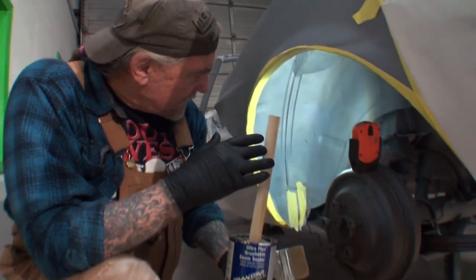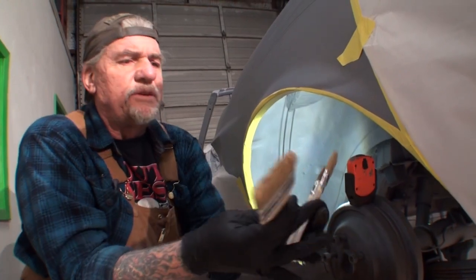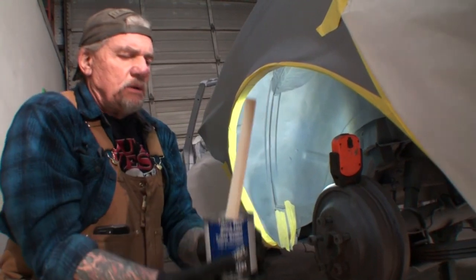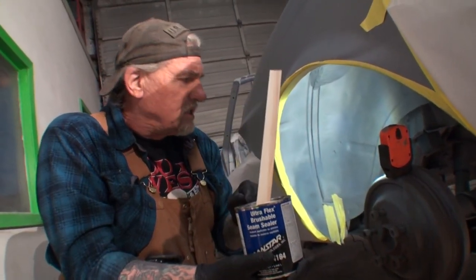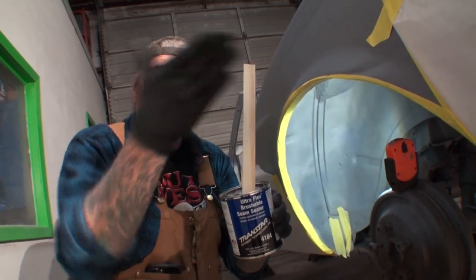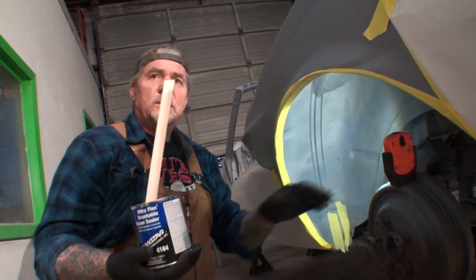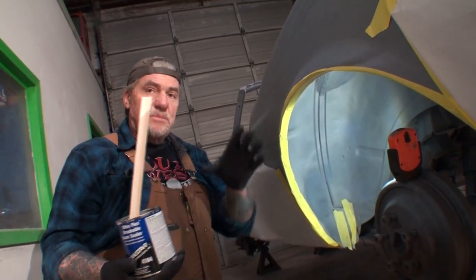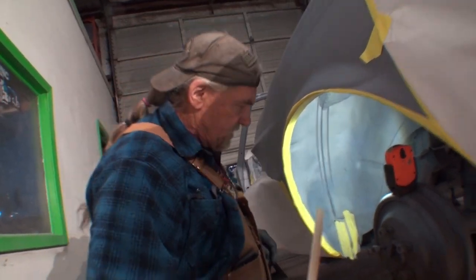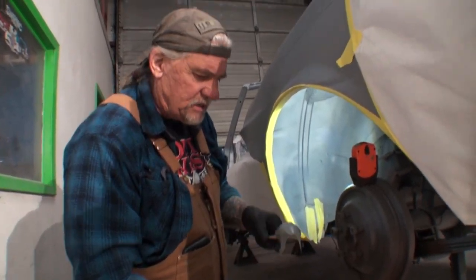All right, so I got my seam sealer, I got my paint stick, I got my rubber gloves on. Very important to have for this job. I also got my three throwaway brushes. The first thing we're going to do is we're going to take our seam sealer with our stick. Now, another item that you can use is if you have a piece of metal, take that piece of metal and bend it so it's got kind of like a curve in it. Do you see what I'm saying, Minnie? Mm-hmm. And then that way you can use it as a spoon. Could you use like a narrow putty knife and bend it? You can use a putty knife if you want. A flexible putty knife and bend that. But what we're going to do is we're going to go ahead and apply it with our paint stick, and we're going to take our seam sealer just like this,